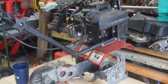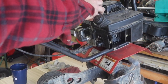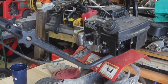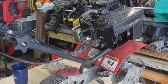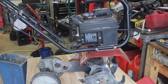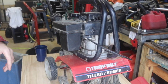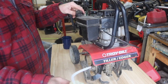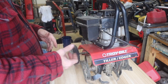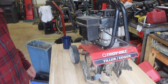I anticipate that if it starts up the tines are going to start spinning. I'm going to go straight to the carburetor. Logical would be to fill it up with fuel and see what happens, but then I'm going to have a mess of fuel on my hands taking out and changing all the fuel lines and cleaning the carburetor out. So I'm just going to go straight in to clean the carburetor. But the motor runs — I saw those tines spin. So let's clean up this carburetor and see what we get.